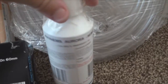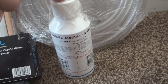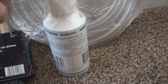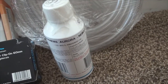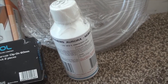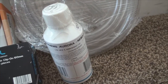On the side here we got the Mayhem's Aurora Nebula Blue Coolant. I thought I'd try this for a bit. A few things to note for anyone looking to buy it: this stuff is probably only good for about six months in your system, then drain it and put new coolant in. It's not really made for high-restriction builds or builds with low points where particles could settle. You also need a pretty powerful pump. I'm going to give it a try, and in about three months I'll drain it and see if there's any damage done to my system. I'll keep you guys updated on that.